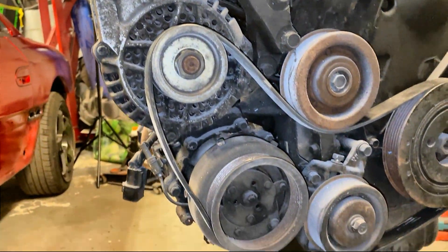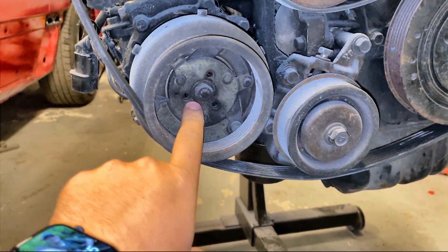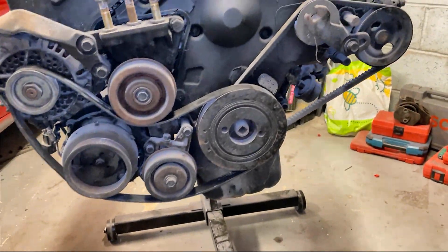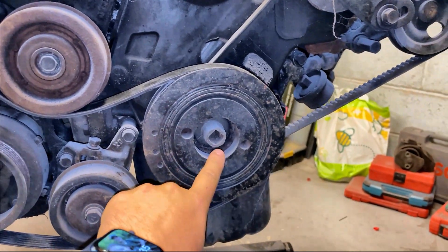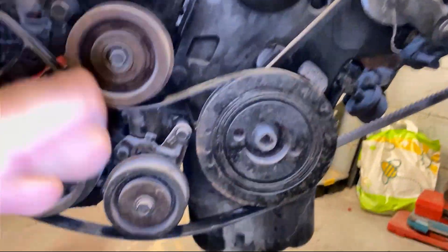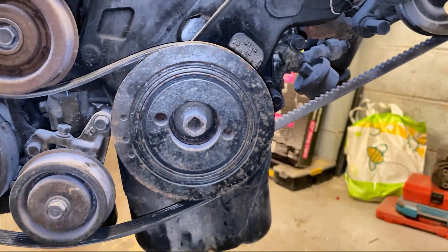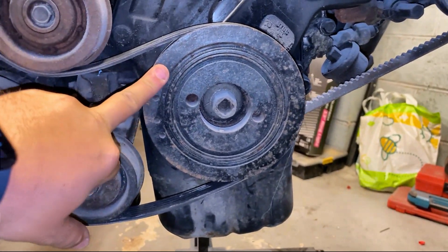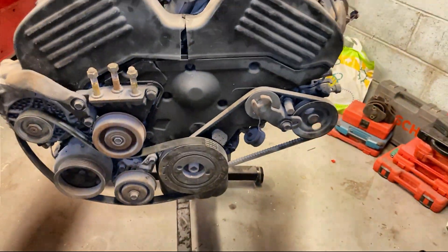The belt hasn't really run much since being fitted, but the issue is it's been sat for 10 years before I picked it up — rubber deteriorates over time. Same for the auxiliary belts, the power steering pump belt, and all the tensioners and idlers — they're all getting changed. The alternator still works as far as I'm aware, as does the air conditioning compressor — it still spins. The harmonic balancers are in two parts: the center which bolts to the crank, a rubber intermediate section, then the outer which drives the aircon pump and alternator.